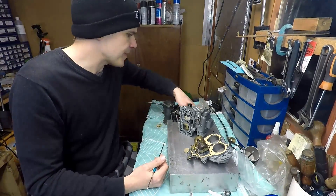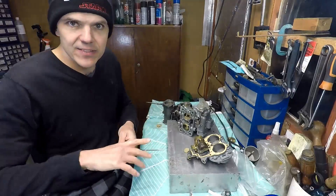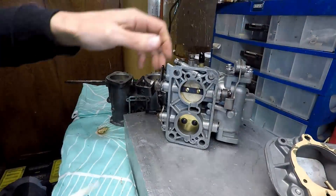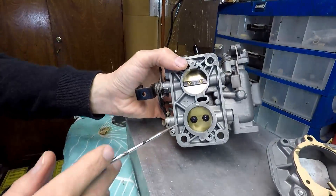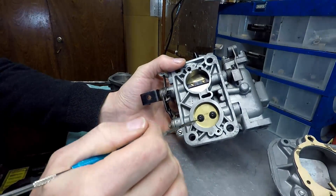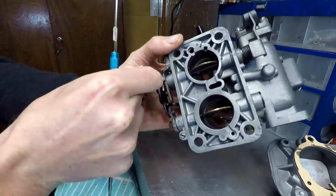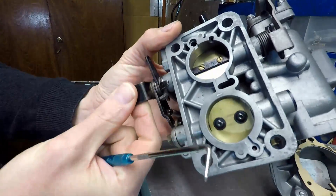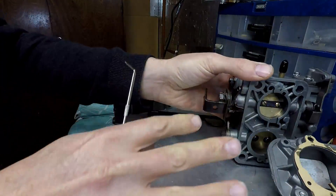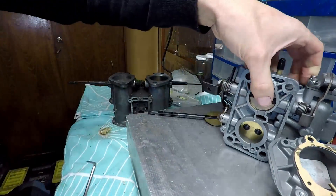What I'm going to show you today are the little bits about how to improve the flow and power tune these 32 carburetors. The first thing I want to show you — bringing the camera right here — is the modification I've done: I put lower-profile throttle screws and cut one side of the throttle shaft. The aim of that modification is to permit a higher amount of airflow through the throttle plates, helping the carburetor flow more at wide-open throttle.